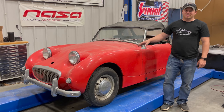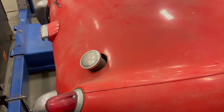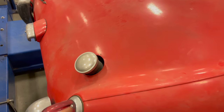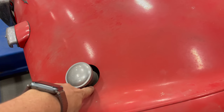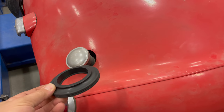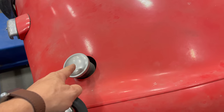So it's time to get back on this car and see if we can get it drivable. This car needs a new fuel pump in order to run, but the reason I didn't just throw a fuel pump on is because there's a gasket missing here between the body and the filler neck on the fuel tank. Here's what the gasket looks like, but in order to get it in I'm going to have to drop the gas tank.